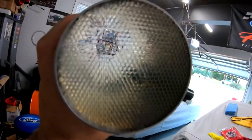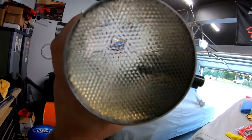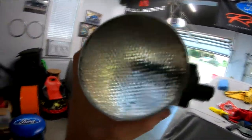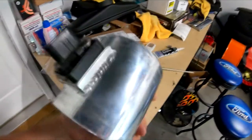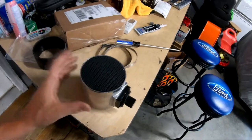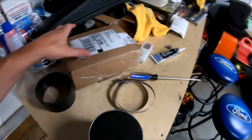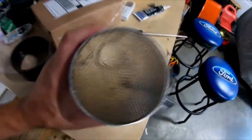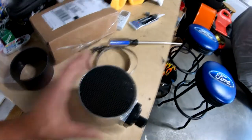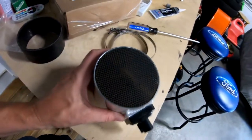This is going to help clean up the air as it goes into the mass air meter, and now the computer should get a much cleaner signal. The car shouldn't have any kind of drivability, bucking, or issues when it gets all the extra airflow. So there you go — just a little quick tip. If you have a ram air cold air kit on your Pontiac G8, Camaro, or anything like that GM style, Treadstone is the company that makes it. It's just a little honeycomb insert that'll clean up the mass air readings and give you back that stock-like drivability.